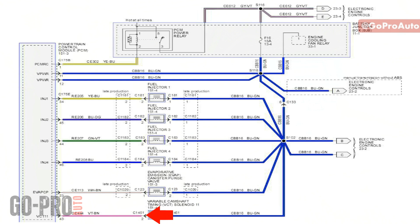Pin number two is the ground provided by the engine control module — whenever the ECM wants to activate the solenoid valve, it provides this ground. Pin number one, the blue-green wire, is the power supply provided from the fuse box. It comes from fuse F16, a 15-amp fuse inside the battery junction box, which is also provided from the PCM power relay. If there's a problem, it's most likely not that fuse, because F16 also powers the injectors — if that fuse were blown, the engine wouldn't start.